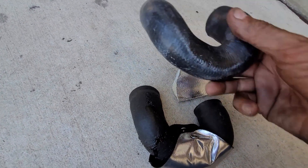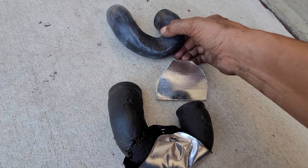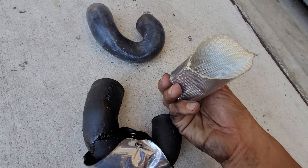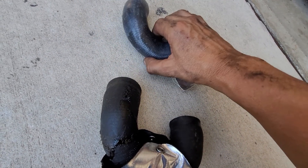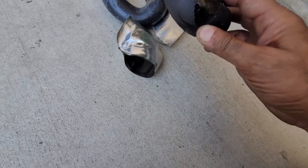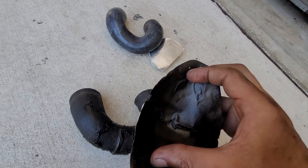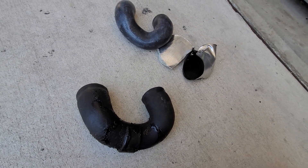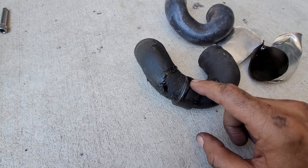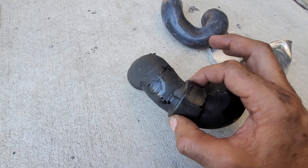Earlier I had recommended, I think in part one, getting the Gates hose because it's pretty much the same. But I had a few minutes and I pulled the sleeve off the Gates — just foil covered, probably asbestos or something, that goes right there to protect it from the waste gate. So I took a look at the factory one. It's got a button right here, unbuttoned it, pulled it out of the sleeve. Now this is foil with a little different material. I don't have a heat gun, so I'm going to try to figure out which one's better or worse. They're probably relatively similar. But the OEM hose has this big bulky extra bit, just to keep it from getting overheated in this area.